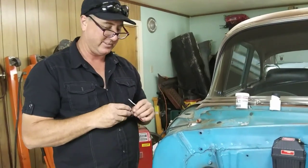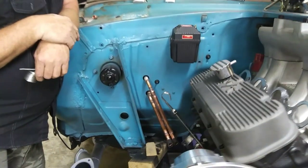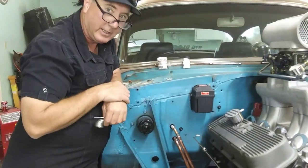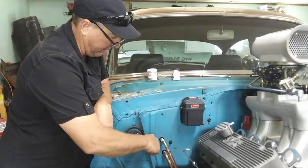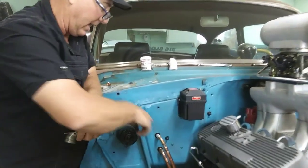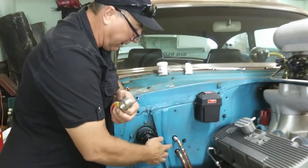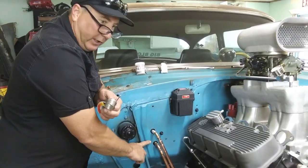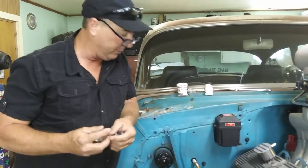All right, here we are at the last stage. Chris and I got together on the old vice — we pre-brazed all the joints up. Now we're just coming to the point of doing the last joint into the heater box itself. The situation is that we've got copper coming out of the bottom and aluminum coming out of the top. They brought copper to the actual diverting valve because it's more solid and can take the heat a little bit better, even though it is an aluminum heater core.